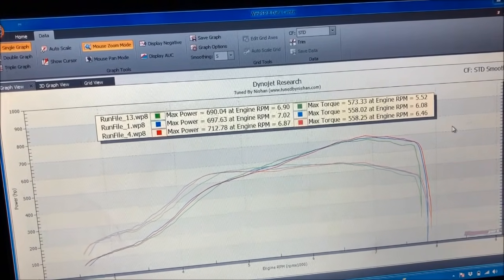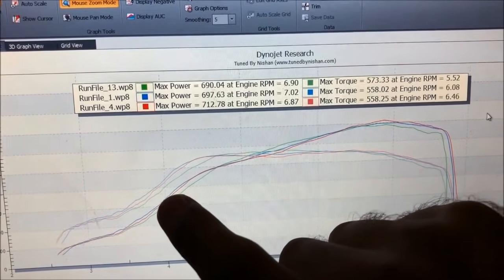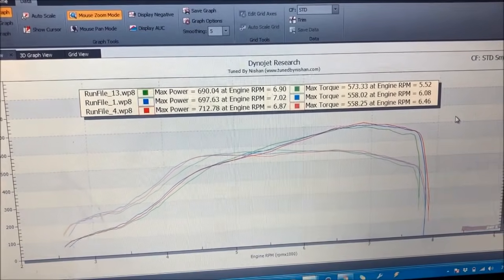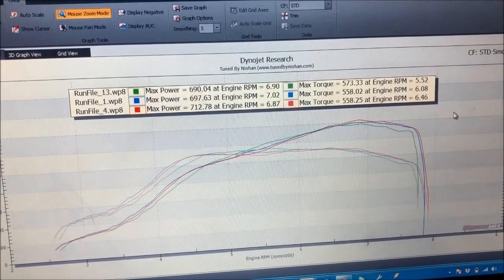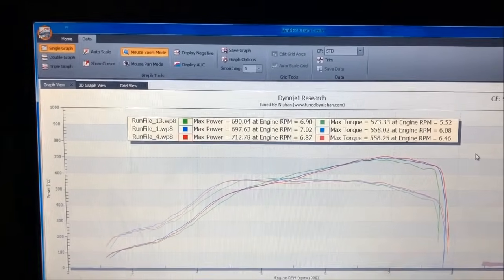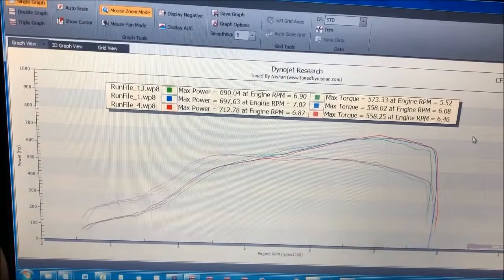call that the result of the wastegate spring, because even on the one bar spring, we were able to manipulate that through duty cycle to the wastegate solenoid. So it's probably just because it's a little bit cooler. I'm not actually sweating today, so that's pretty much where we're at. And I'm still glad that we tried it, got to take a look and just see what it could do.